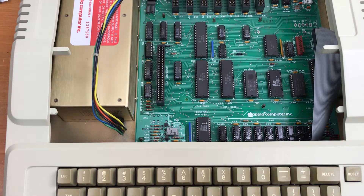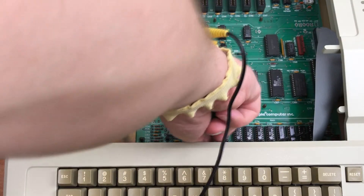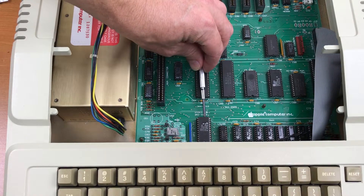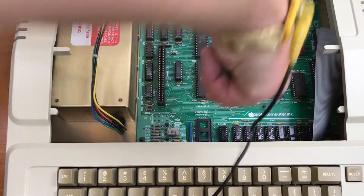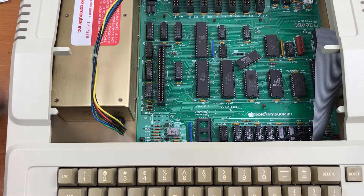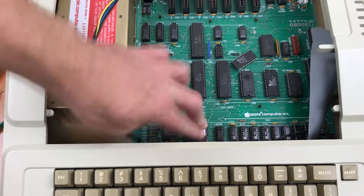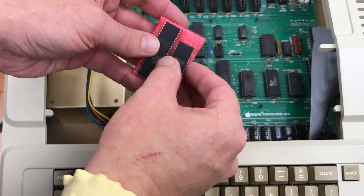Removed all the cards to make room, unplugged it, and now let's pull out the video ROM. These older units, the chips can get really stuck in there. Wedge up one side with a screwdriver, see if we can get the other side to come out. There we go. Pins look good. Put it back down there. Put the new chip in. Put this down and we'll replace the old chip in the anti-static foam.